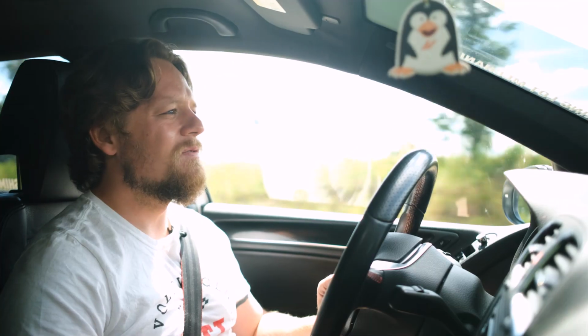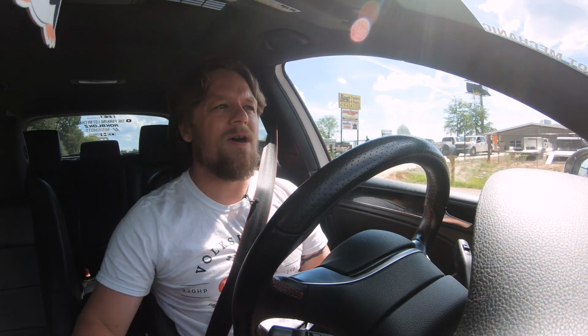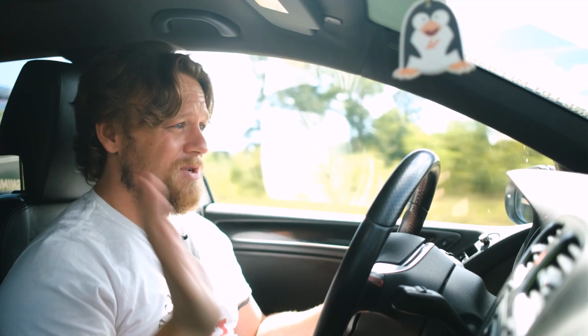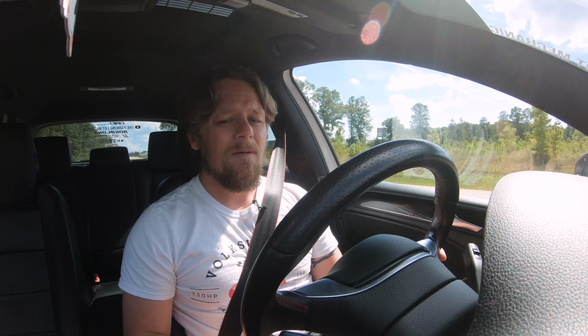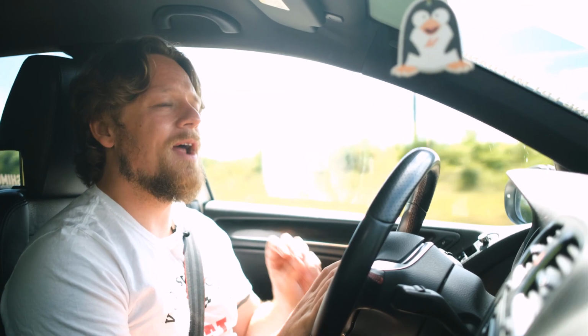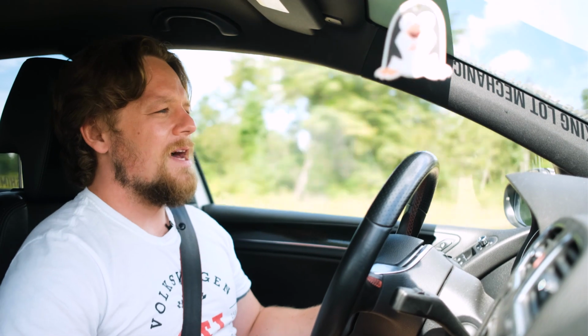And when I did the pulley upgrade on my Audi with the V6, both the crank pulley and the power steering pulley, absolutely loved it, was doing so well. Really helped make that car just that much smoother, put the power down that much better. I know it's a big hefty lump of a V6 making less power than this turbocharged engine. That was also 15 years ago from this, but because we lightened those pulleys, it helped put that power to the ground, helped increase acceleration, really made it a more lively and punchy car to drive instead of the luxo barge that it was. There's a lot of stuff that's compounding.